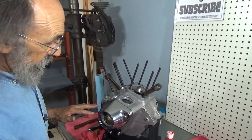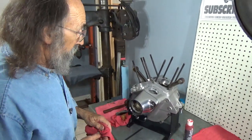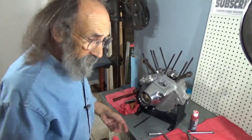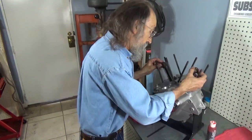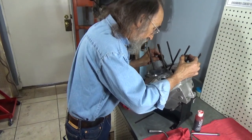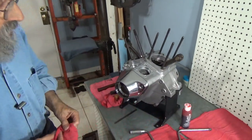And we know the breather gear end play is correct. And we have all the timing marks done. The cover is torqued down. We can say we have finished putting the Camchest together. We can even move the rods and watch this little thing turn and be happy. Everything looks just wonderful. So that really does it for now.